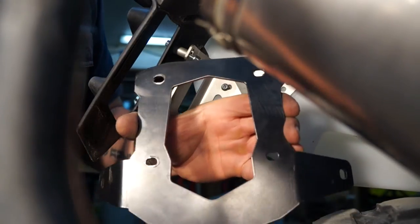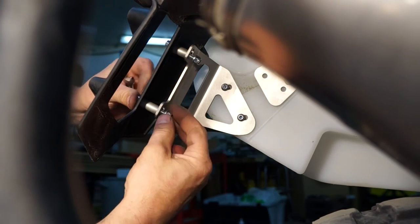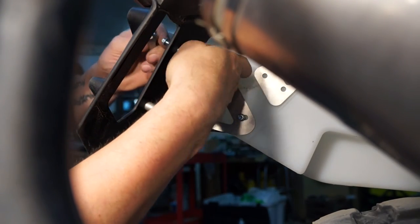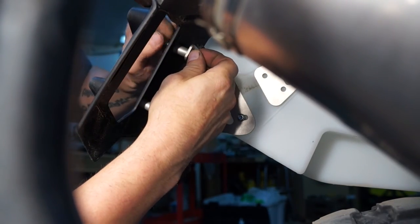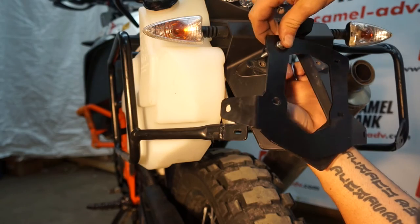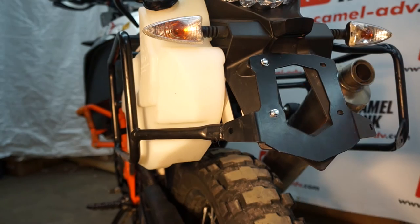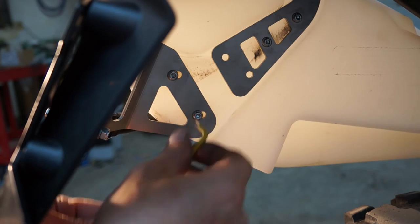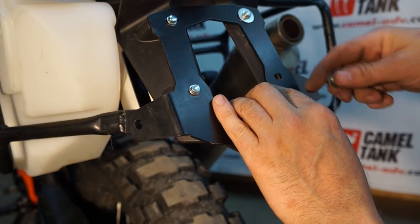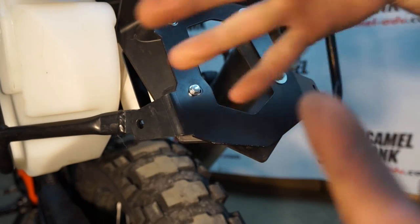We need to put on the rear license plate mounting bracket that the crossbars mount to. These are already loose — I'm going to take the M6x45s out and put the license plate mounting plate on here, then the M6x45s back through the holes they just came out of. You may have to loosen these two — they were previously Loctited, so you may have to take them out and re-Loctite them with your license plate mount on. Go ahead and put the rest of the bolt to your license plate on, leaving everything loose until you get it lined up.